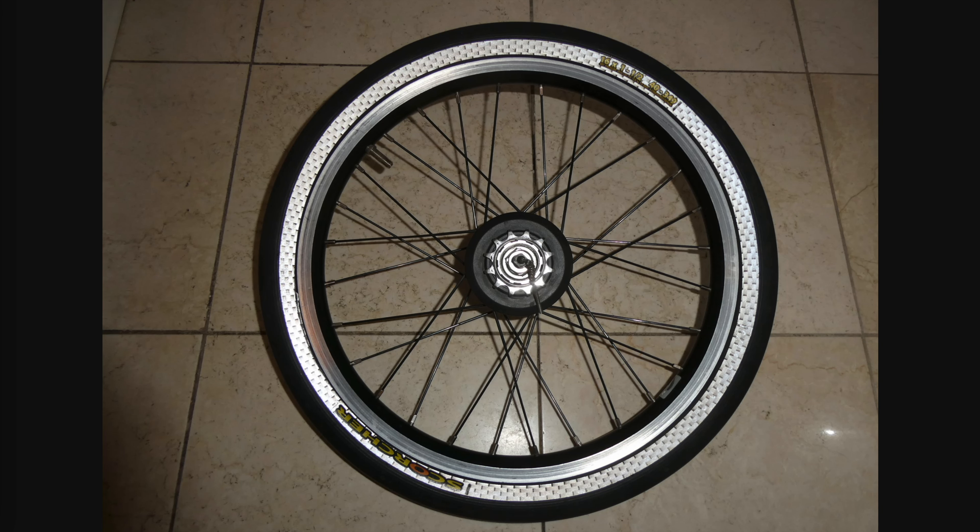To prevent another flat, I bought a tire liner, which is almost as good as what you get with a Continental tire that fits the Brompton, or the Big Apple by Schwalbe — probably the best tire I've ever had. I put the liner in and it was too long, designed for a 20-inch wheel. I followed the instructions on the box and did not trim the excess length but overlapped it instead — this was a very bad decision.